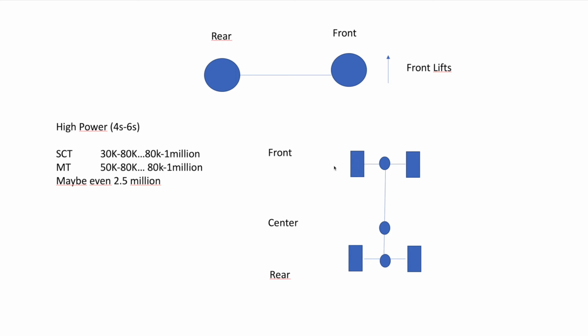You could spin this wheel, have this one on the ground and this one, and anyway, you can spin this wheel and these will spin easily, even if there's some friction. So if there's light friction, you can spin one of these and one of these will spin. Just depends on the oil here in the differentials, which wheel will spin, or both. But that is something that you're probably going to be using, or anybody will be using, for high speeds, going straight.